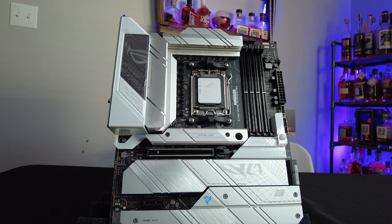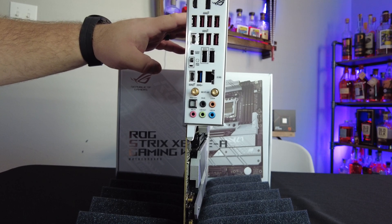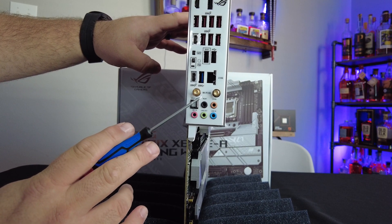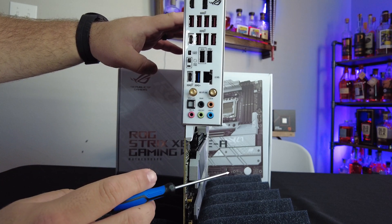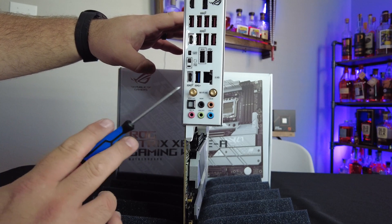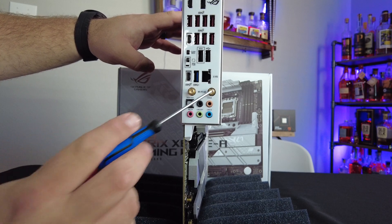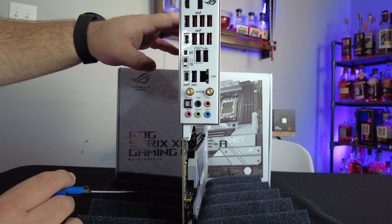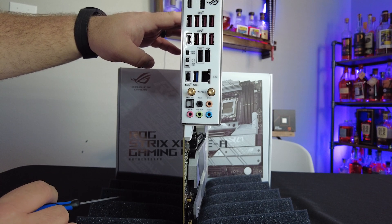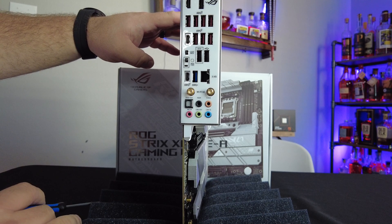Let's wrap this overview up with a quick look at the headers and the rear I/O. There's nothing too crazy here on the rear I/O. You have your full complement of audio ports, the connections for your Wi-Fi. I do want to point out that these are all Gen 3 USBs — more than adequate ports for all your connections. Two USB Type-C's, and one of these is an actual 20-gigabit Type-C plug. There's also a 2.5-gigabit LAN connection. And you do have a clear CMOS button and a BIOS flashback, so if you want to do some heavy tweaking and make a mistake, it'll be just fine.